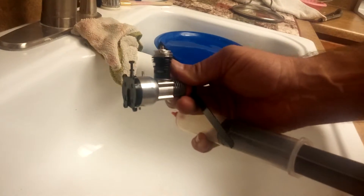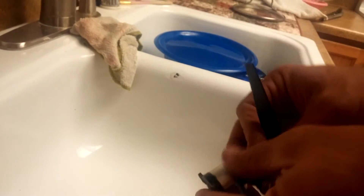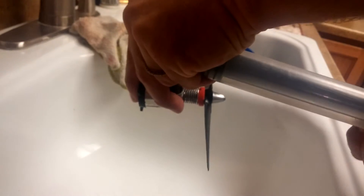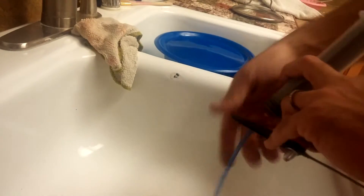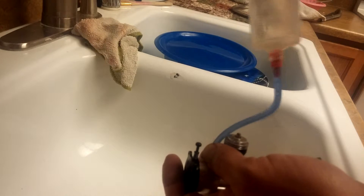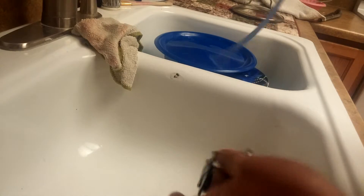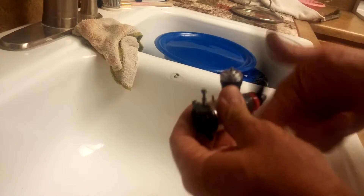Take your empty syringe and just blow through the tank. It doesn't have to be perfect because it will evaporate, but suck it out and drain all that alcohol out of the tank — sucking it out and then blowing through it. Do that a couple times, then flip through it again.